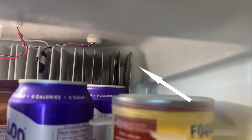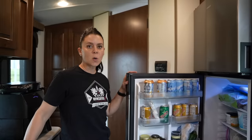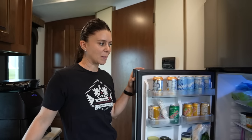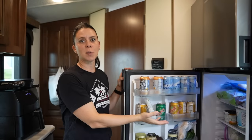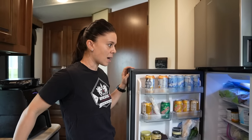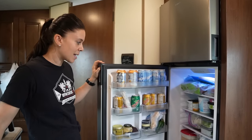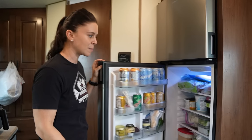Next to the coil it's extremely cold, stuff will freeze, and on the bottom things could actually spoil like meat. In a home you usually don't think about where you need to put certain items for performance purposes — like putting vegetables in a certain spot and them freezing, or meat in a certain spot and them spoiling. In the RV before this fridge, I'd always put meat on the top shelf. Now I can just mix and match my containers. There are RV hacks with 12-volt computer fans, but it's kind of ridiculous that we have to hack a brand new refrigerator just to make it cool properly.